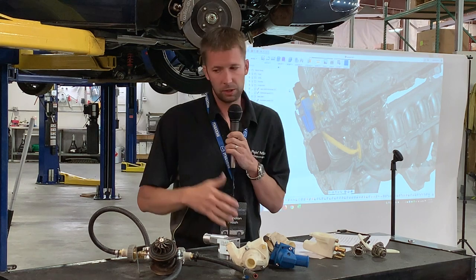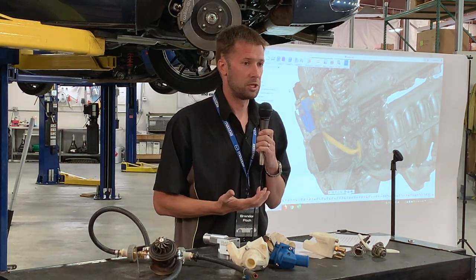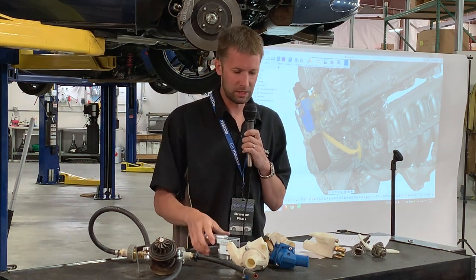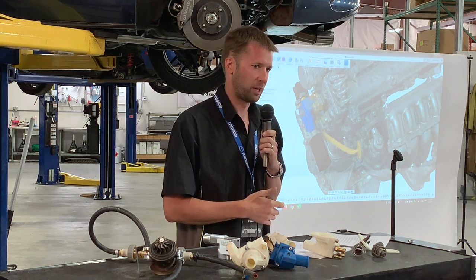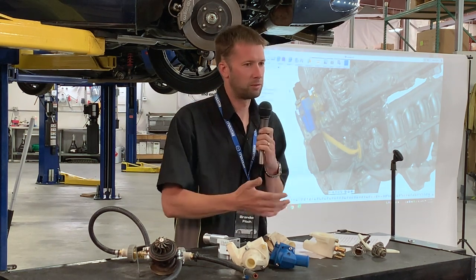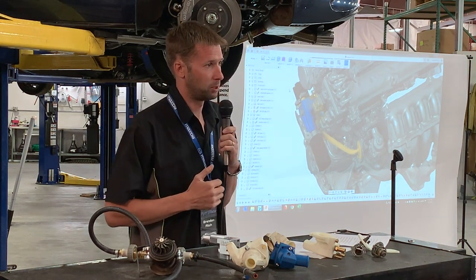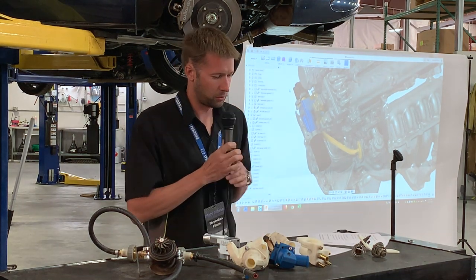And check EGR clearance. That's a 99 EGR. Does it work on a 94, 97? Because that's a different EGR. Tweak it a little bit for that. Does it work with our EGR? Well, our EGR actually has a lot more clearance, but that means that we can't have the ECU coolant temp sensor where we thought we wanted it, so now we have to move that. So it's just gone down the line, finding problems, solving problems, to make sure that ideally we find all the problems, we address all the problems, and you guys just bolt it on. No problem. So that was kind of where we went.